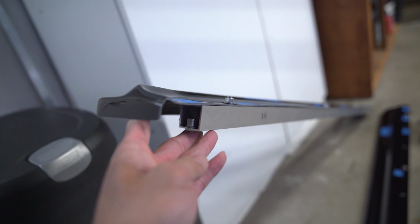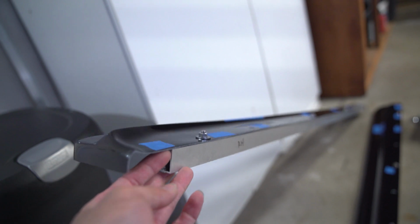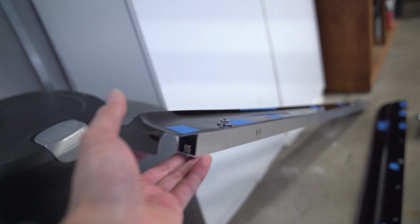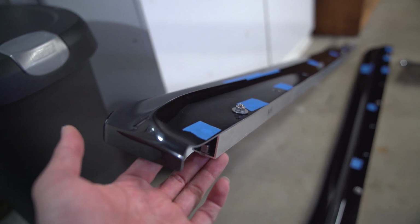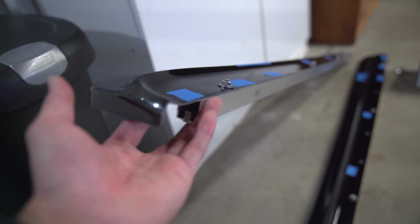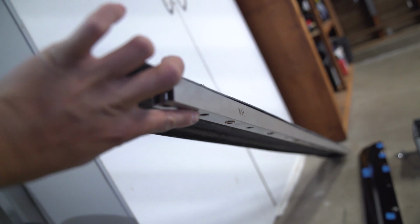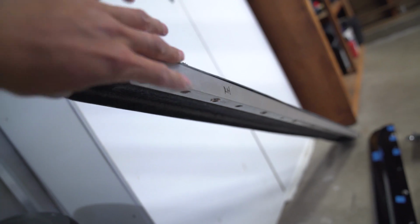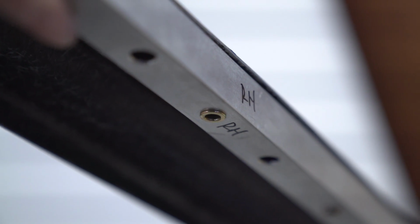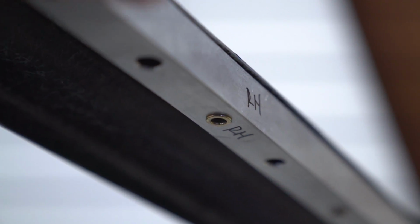So I got this tube right here. This is a square tube, basically, and it's mounted to the bottom of my side skirt. So first, you take the side skirt, you mount it up to your rocker panel, and then you put this tube, and then you run the bolts right here through both into your rocker panel. Now I did that so I could attach the side splitter right here where the rivnut is. That way I can have the side extension and the side skirts all installed in one.